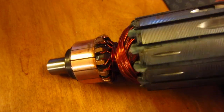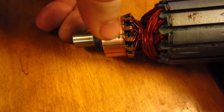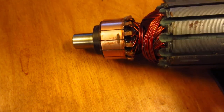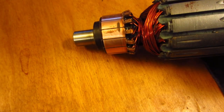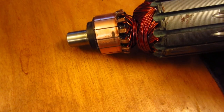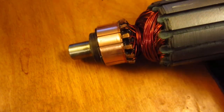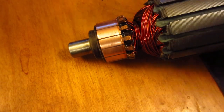This is the armature from inside, and I've already started sanding this down. It used to be pretty black. But the other thing you'll notice, you can see here, there's a burn mark. I'm guessing that at some point during this tool's life, it was either run through something a little too rough and it bound. The blade on here was really dull, so it's possible that it bound up. Looks like it was running through gypsum or plaster, and it was not a plaster blade. But just 1,000 grit sandpaper in a few minutes, and the other side's already gone. It used to be right there, but it's virtually gone. You can still see a slight line there.